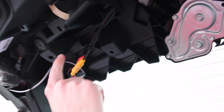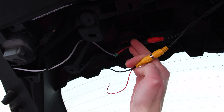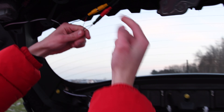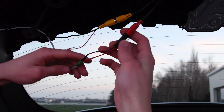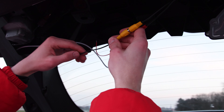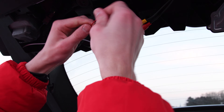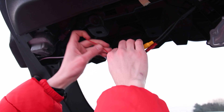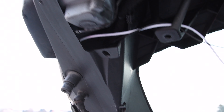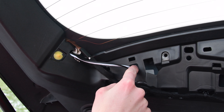Once inside the trunk, you will see that we've already placed two cables for the camera. The white cable is a cable to provide electricity — it contains a positive and a negative wire. Most people have this at home, if not, we'll put the link in the description to buy one. The black cable is a video cable, and we also put the link for this one in the description. We've soldered the male side to an extension cable, but we'll provide a link to the cable where that is not needed so you don't have to solder yourself. The only thing you will have to do is cut the female side so you can connect the positive and negative wire to the relay we'll show later in the video.